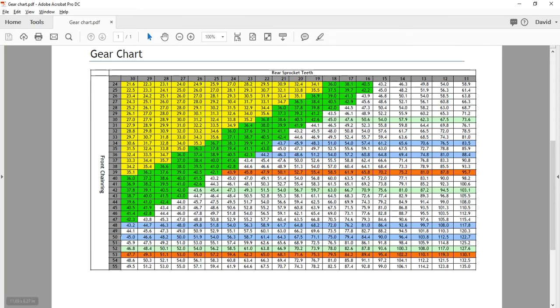Now let's look at the bottom range of the gearing. For a compact crankset at 39, looking at say a 28 sprocket — that's a 37.6 inches, so we'd round it up to around 38 inches. Now if we look at a compact crankset that gives you a 34, the number here is 32.8 — so 33 inches. You'll notice there's not much of a difference between those two gears, but enough to make a difference.